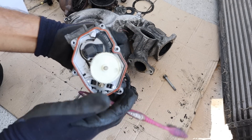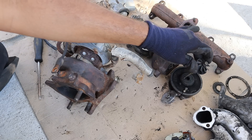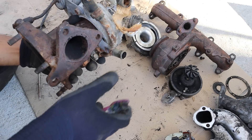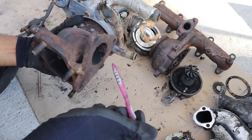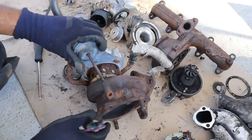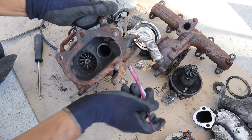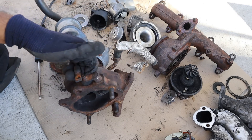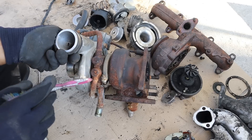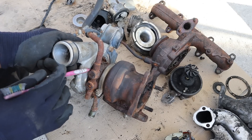There are still a bunch of auxiliary hoses and actuators that are part of this system. Now that we've seen how a 1.9 liter turbocharged diesel engine from Volkswagen looks, here's what the turbocharger looks like from a Subaru WRX 2 liter. Because that engine has two heads, you've got the manifolds that bolt up here and bring hot exhaust gases around the turbocharger to spin up the turbine inside. This is not a variable geometry turbocharger, so it uses a vacuum-actuated wastegate that simply opens and closes to allow exhaust gases to bypass the wheel when too much boost is built up. Being a gasoline engine, it has hookups to lubricate the oil bearings for the shaft, plus two additional hookups for coolant — since gasoline engines ignite via spark rather than just compression, they run a lot hotter, so it's beneficial to run coolant through here.